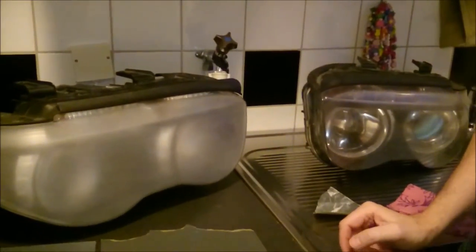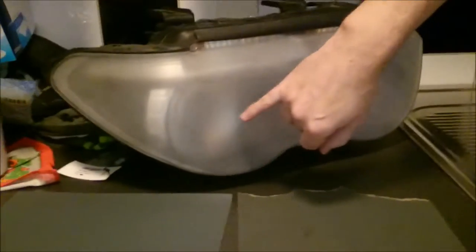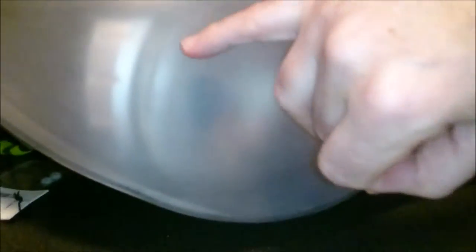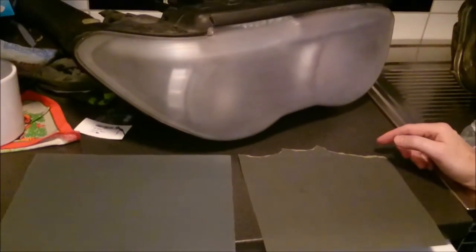You can see by the results here — I've used about 30 minutes or so with 600 grit paper. You can see very clearly the small lines from the sanding, and that's why we are going to use 1200 grit paper afterwards to smooth it out, but you won't be able to see the difference very much anyway.